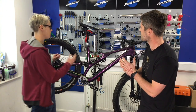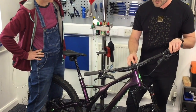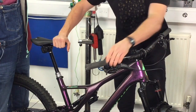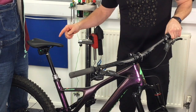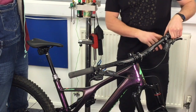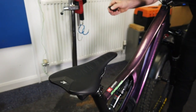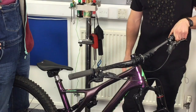We've talked quite a lot about the drivetrain. Let's have a look at the dropper post and the other cool thing about AXS — getting rid of all those cables, hoses, and clutter. It's all super neat at the front. You have two hoses now: a brake hose and a brake hose, and the rest of it's all done electronically, wirelessly. Eagle Controller on this side and Reverb Controller on this side. And that button — if you can just about hear it — is actuating the motor and gearbox inside the seatpost, which is allowing you to drop it. It works on radio frequency, Bluetooth, ANT+, and it is as close to instantaneous as can possibly be.